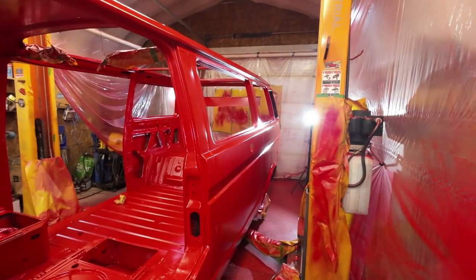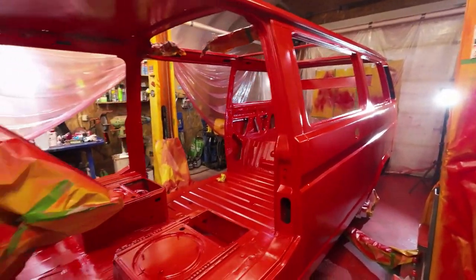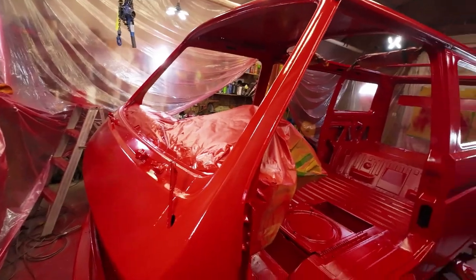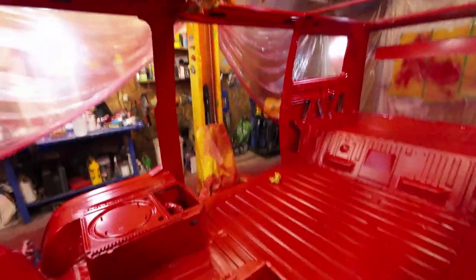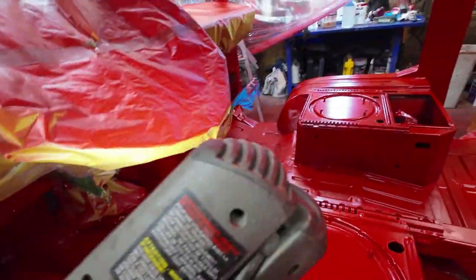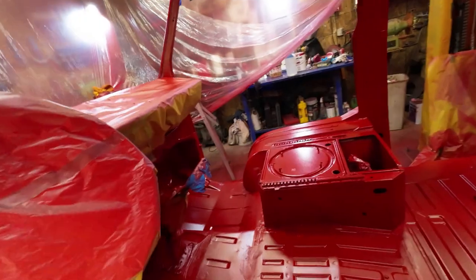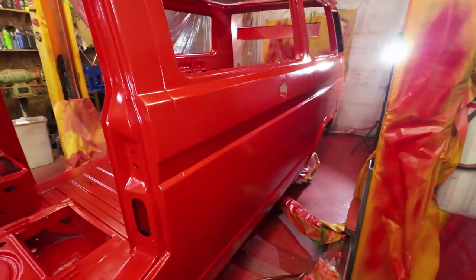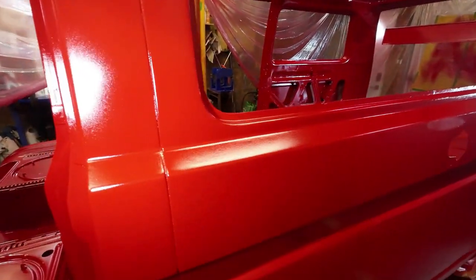Yeah, now here it is tomorrow, right? Already. There's three coats on here for the most part. One coat on the interior, which I think is covered fine, because it's all going to be enclosed and there's going to be carpet on the floor. The floor actually all looks pretty good down there. A couple of spots would use a bit over there in the corner. I didn't get it. And this corner here, yeah, I got that corner. But then as I was going along, the gun started clogging here. Can you see this? How close can I get here? A little bit of orange peel on here.